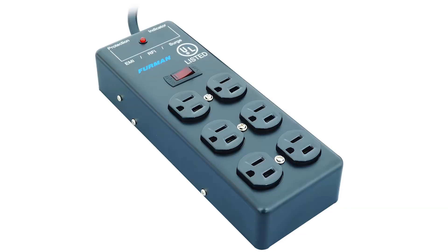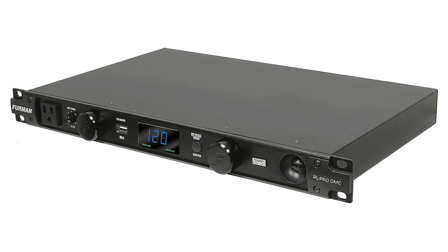Next is a power conditioner. A power conditioner is similar to a surge protector in that it's changing the power, but with power conditioning it's actually taking dirty power coming out of the outlets, normalizing that voltage, and sending it to your device. Household voltage varies — it goes high, it goes low. A power conditioner sends out a steady stream, keeping it as level as possible, which is actually going to save your electronics, make them last a little longer, and filter out some of that dirty power.